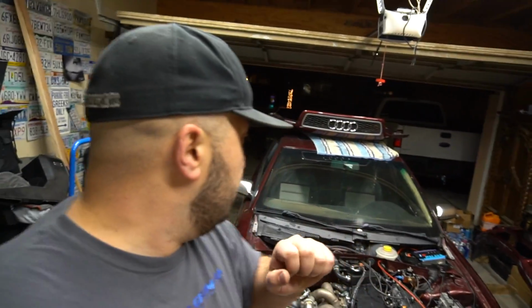But we had a small coolant issue. She wasn't overheating, but she kept spitting coolant out of the bottle. We misrouted one of the hoses in the back and one of them was kinked. So we got that fixed. We've been letting her run now for about 30 minutes.